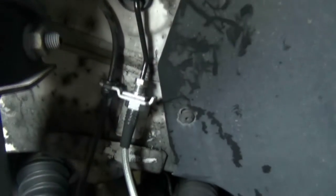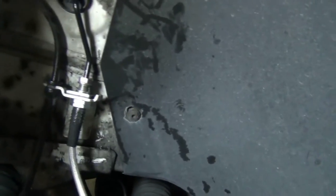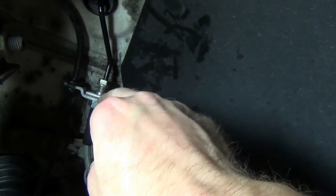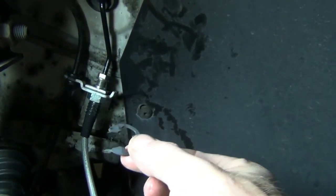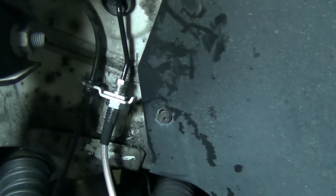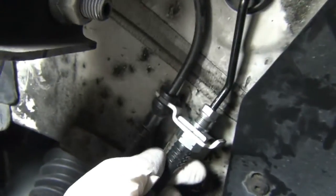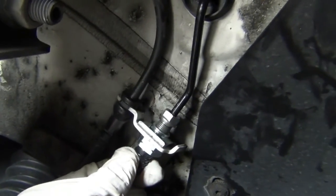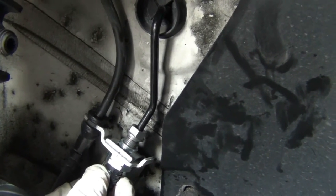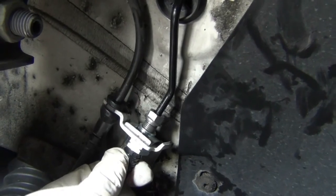I'm not loving this end at all — I'm not liking the install. When I use this C-clip, it's completely loose; it's way too thin. I'm trying to put on the stock clip and it keeps snapping out, so I'm trying to squeeze it together and push it in to keep it solid. The notch is way too big and this clip is way too thin — it totally moves around in there, and that's not a way I'd leave my car. I've tried to tighten it and I'm not going to leave it like that. I'll try to work a little more on that clip.